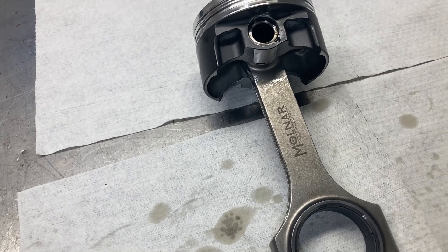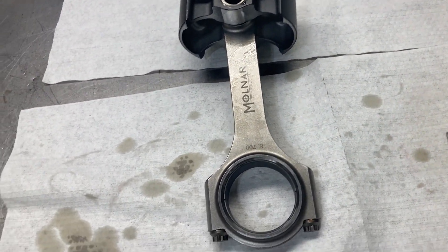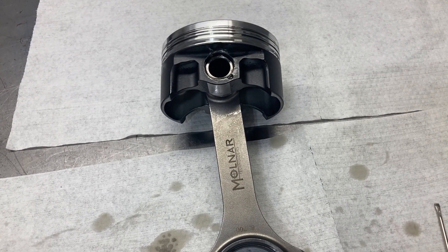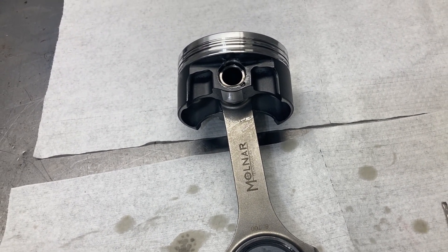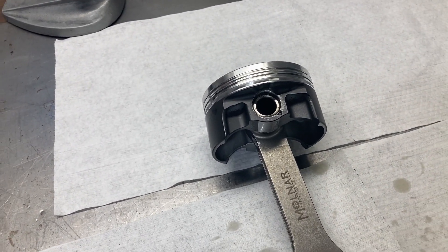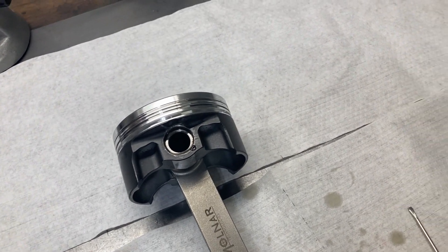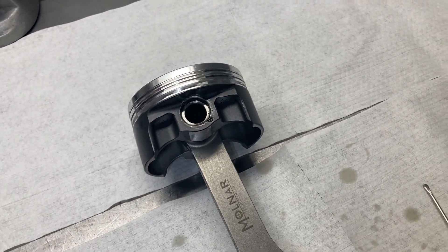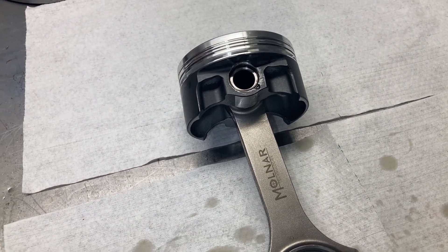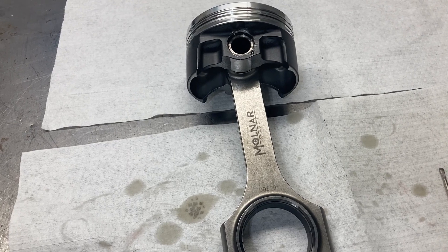We're using a custom camshaft for Mr. Dennis. He's going to be running a set of Webers after he gets it home from the dyno. Due to the hydraulic roller advertised durations and RPMs he's wanting to run, and trying to cut down on reversion, we lengthened the lobe separation angle quite a bit. The typical hydraulic roller cam core for the FE is generally limited to about 114 or 115 degree lobe separation angle, so we went with a full round billet — basically you can make whatever you want out of it. It's going to take several weeks longer to get and it's a little more expensive, but I felt it was the best choice for this build.